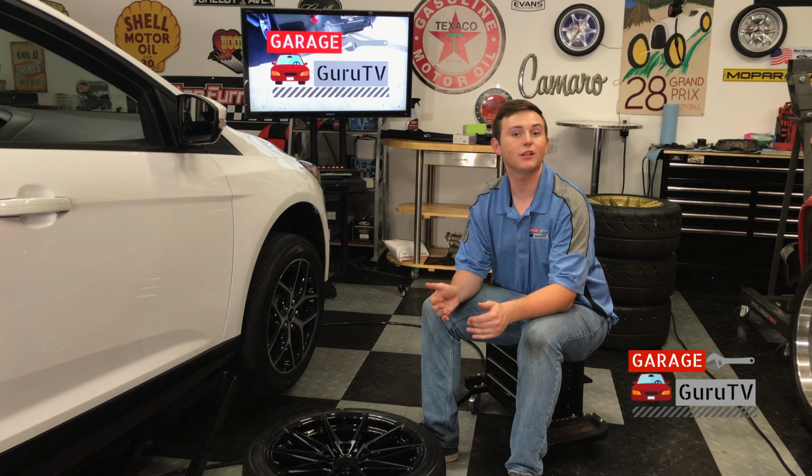When we first received our set of XXR 567 wheels, we tested them for fitment on our Ford Focus without the tire mounted. We checked for things like brake caliper clearance, strut clearance, fender clearance, and things of that nature so that we don't have any issues. Even once you get the tire on, you're gonna wanna check all those things again because it's good to check twice, so that you don't have any issues while going down the road.